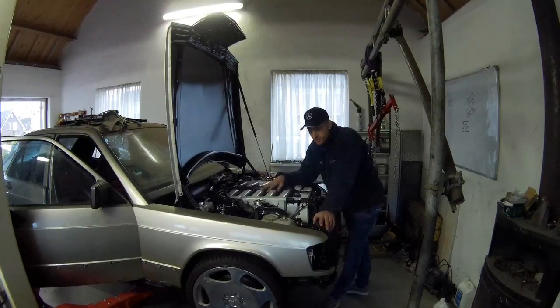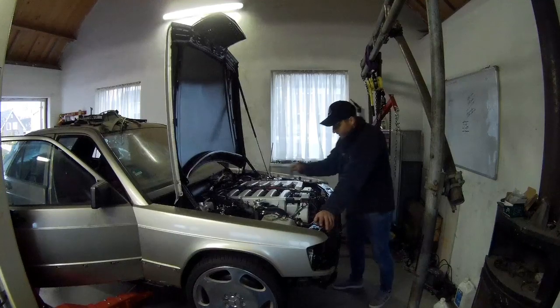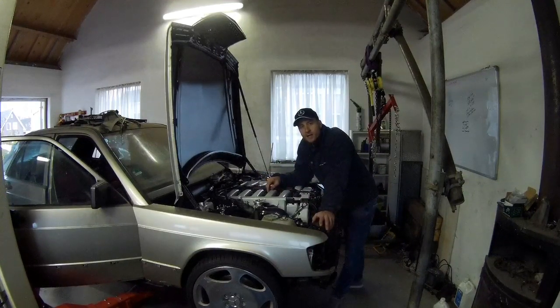The oil levels are good. And I need to get all the air bled out of the cooling system, because now I'm waiting for the engine to cool down, as it went up to 95 degrees Celsius. The engine is running a little bit high in idle, around 1500 RPM, and the cooler cannot keep up with the temperature because I'm not driving. The fans are on, but it will not give me enough flow.